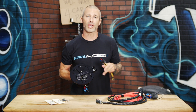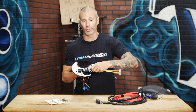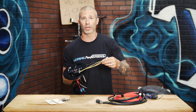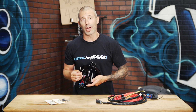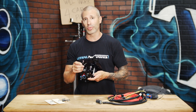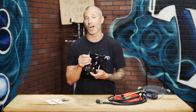If you are not using our return style wiring harness and using your own wiring, we offer the DX0045 pigtail. This will also plug directly into the fuel hat and has the four power wires and ground wires, as well as two level sender wires. You'll hook it up the same way — yellow to yellow and black to black. For the level sender wiring, you have two wires on the underside of the fuel hat: one has a spade connector and the other has a ring terminal. The ring terminal gets grounded to the spine of the fuel hat, and the spade connector hooks up to the other wire on your level sender using the spade that comes from the factory on that wiring.